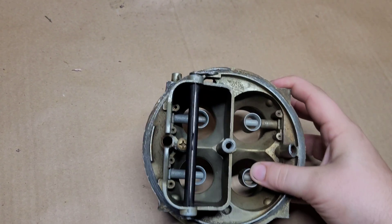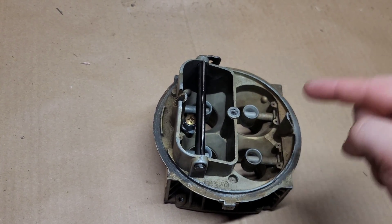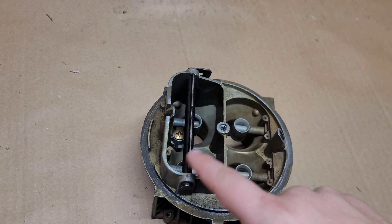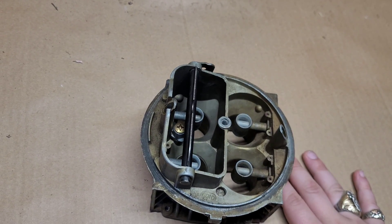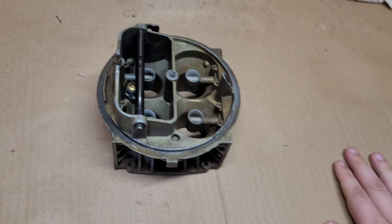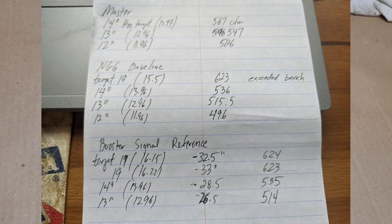What you're staring at is just a plain Jane, about as basic as it gets — a stock configuration 600 Holley, vacuum secondary, no pump shot. This is as basic bare bones a carburetor setup as you could possibly get. Still even got the choke on it. We flow tested this, and here's the numbers. That is what that carburetor flows completely stocked, with a stock 600 base plate.